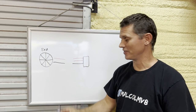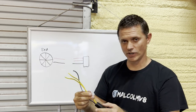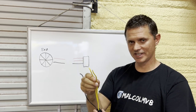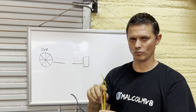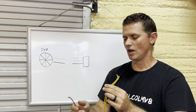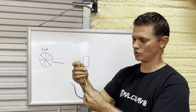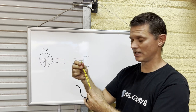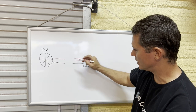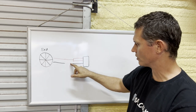Stage one wiring is for guys who just want to make it work and just want the fan to turn on. On the factory harness there's going to be a ground wire and then a high speed and a low speed fan wire — in this case they're both yellow, though most OEMs have an orange and a red. You don't need to know the difference between high speed and low speed; you just need to know which one is ground, which is always black. What you do is take the two high speed and low speed fan wires, join them together, and connect them to the one Mach 8 fan wire — essentially pinching those two together as one and joining it up there, then join your grounds. That's it, the fan will come on.